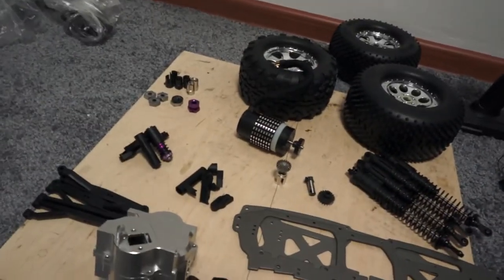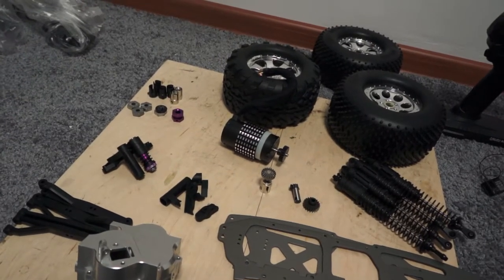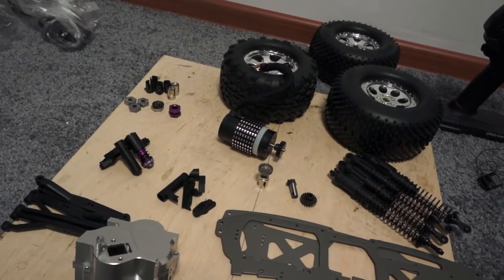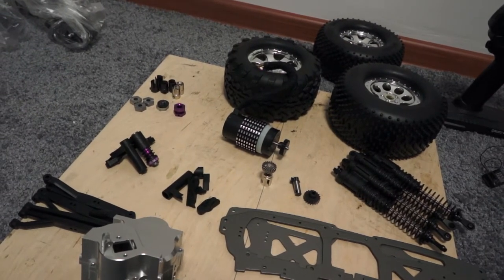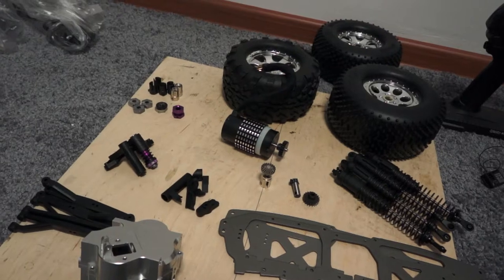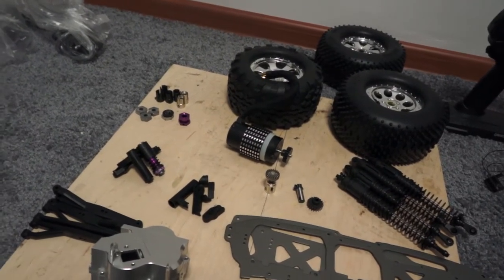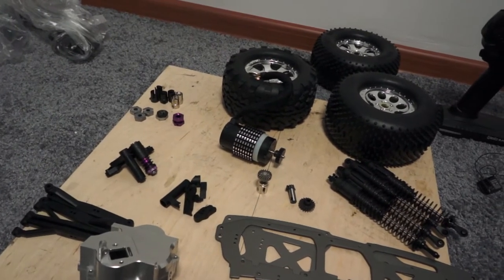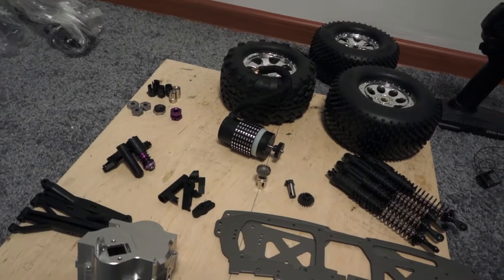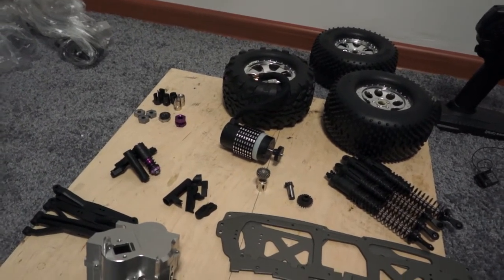And my nephew actually does have two 11.1 volt, 8.4 ampere hour batteries, so 8400 milliampere hours it would be. And we tried it, so with a stock gearing of 20 to 44, it runs like crazy. It's very hard to control, but yeah, there is a fun factor to it, of course.